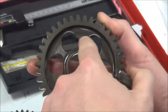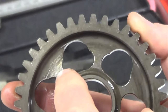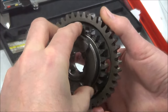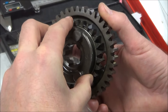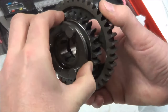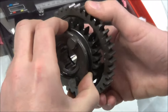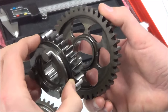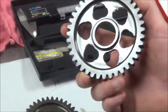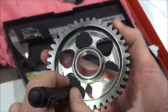The other thing you always want to do is look on both sides of the slot. What people forget about is de-acceleration. They'll get really focused on acceleration because the customer says when I grab a handful of second gear it wants to slip. Well, when you decel pretty hard too, you bang the backside of it, and you might have some binding or noise going on. So we're going to look at every single one of these with a flashlight, very intentionally.